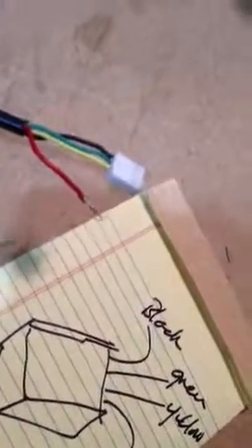One thing to be aware of on the wire: there are two crimping rings on each wire. One should be crimped around the insulation and one should be crimped around the metal of the wire, making contact there. If there is a problem with that, we may have to discuss that further, but this is the general process of de-pinning the white pin connector on your motherboard.